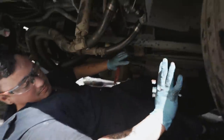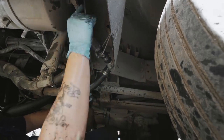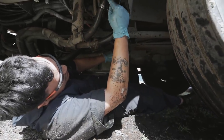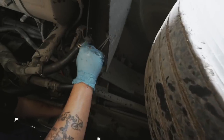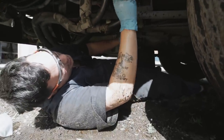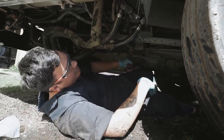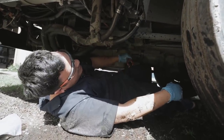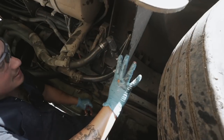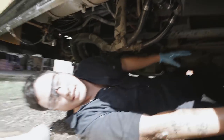We got stuff all over us. We basically cut the coolant hose that was going up, then used fittings and created a U so that the coolant can still travel through — basically doing the connection that would normally go through the heater. I just hung it up so it isn't flapping around by the tire. It's not pretty, but that's how you disconnect the coolant lines and heaters inside the vehicle. Just know you're going to get messy.